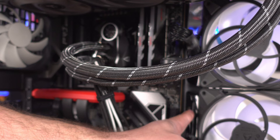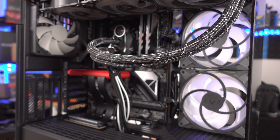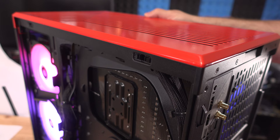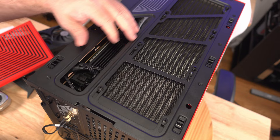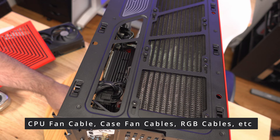Like the Y60, the Y40 has 90-degree cable routing openings so you can slide cables in and out from the rear. There are also grommets up top for the same purpose. Along the top of the case, you can grip a little groove to remove the top panel. There are perfect holes for your 8-pin or 8+4-pin EPS power connectors — whatever you may have — along with support for up to a 360mm radiator.